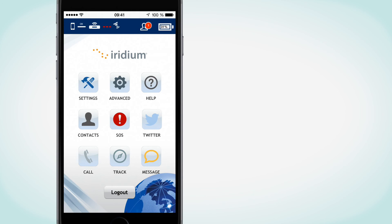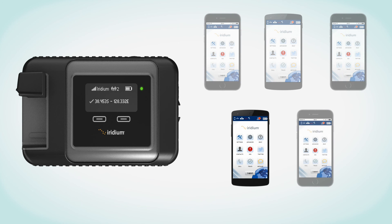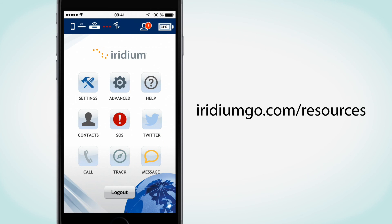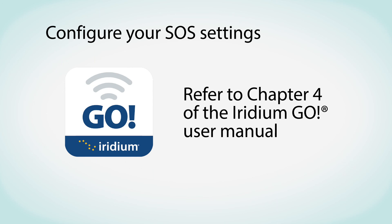The Iridium Go app's Guest User Profile provides up to five smartphones and tablets access to all functions within the Iridium Go device. Up to five smart devices can be wirelessly connected to the Iridium Go, allowing one user to make calls or access data at a time. To create or delete user profiles, edit privileges, or control access for individual users, go to the Advanced menu and select Users. For more detailed guides on the setup and use of your Iridium Go applications, visit iridiumgo.com/resources. It is important that you configure the SOS settings in order to enable emergency services. For more information on setting up Geos and obtaining emergency assistance, refer to Chapter 4 of the Iridium Go User Manual.